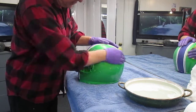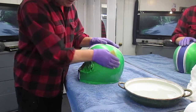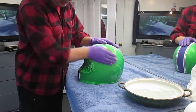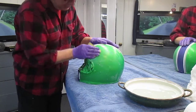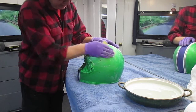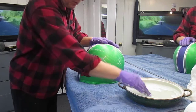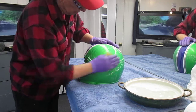In the past, what I've done is I've used 600 sandpaper, 1200, and then I started thinking — wait, I have some 500, I had some 600. So I said, let me go in the other direction because I'm going to put a lot more clear on this helmet. What I'm really using the clear for now is just to seal in the finish that we have — the green. And by the way, the green and the purple, or blue, whatever color you want to call it, they seem to really get a lot nicer with those last couple of coats of clear.